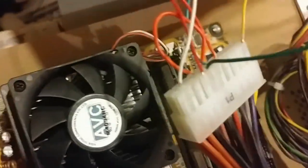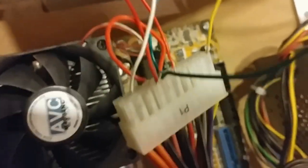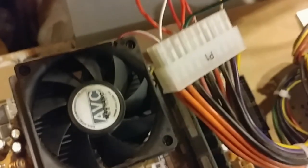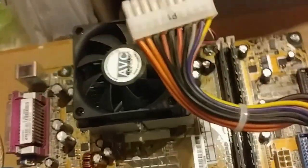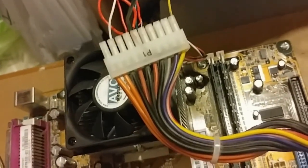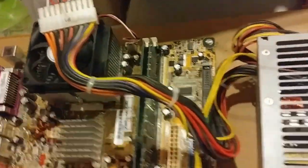This is a 20 pin ATX — you can look up the pin out. Notice there is a jumper, essentially this curved wire here. To get a power supply to turn on, you have to short out the green wire and a black wire. Blacks are the grounds. That tricks the power supply into thinking it is connected to a motherboard and that the power switch has been pushed.